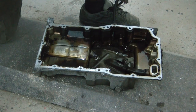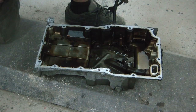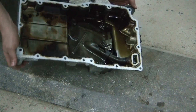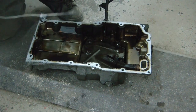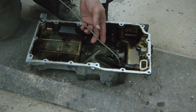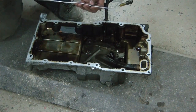We have the oil pan off here. I ended up dropping the bolt for the chain guide tensioner down into the oil pan, and we also had it come off so we could find what was left of the other chain guard bolt that broke off. I can hear some stuff rattling around in there, so I'm shaking it all down to this corner and I have a little magnet here — I'm going to go fishing around in there. This is the bolt that broke.